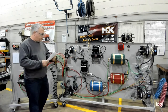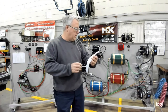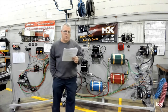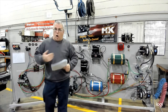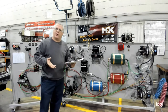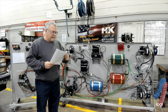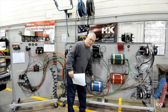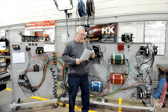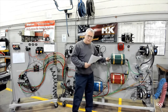Now close all the drain valves and go to the evaluation on the third page. Governor should cut off air pressure at 120 to 130 psi — that's the newer spec. Ours was about 125, so it would pass. If you're not within that range, mark it as fail and figure out why. Number two: one-way check valves in each reservoir protect the air supply in the event of a wet tank failure. We drained the supply tank and both tanks stayed charged by the gauges on the dash — that's a pass. If we had lost air in either tank, we'd have a bad check valve — a very simple fix and simple check.